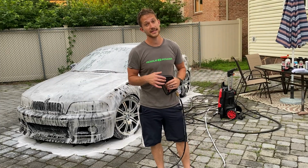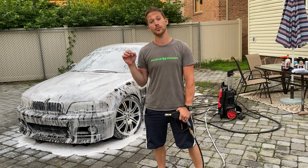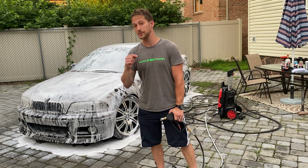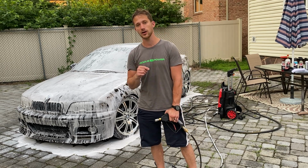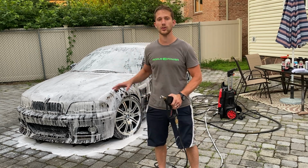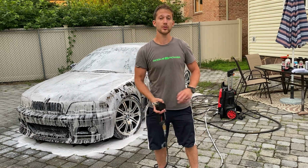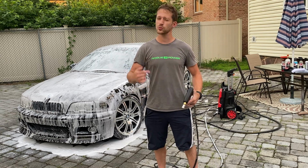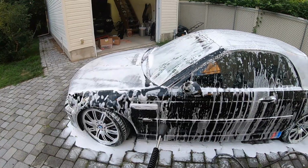Okay, so the next step here, we foam cannoned the whole car. So the next step is quite simply to power wash it off. And this is where things get a little bit different from the traditional two bucket method, which I've made a separate video on. I've linked that in the description below, as I had alluded to earlier. Instead of doing the full two bucket method, we are actually going to power wash all of the dirt and grime off of the car. We are going to dry it with the Sidekick blaster, and then we are going to waterless wash it. So this is where things get way faster and easier than that traditional method.